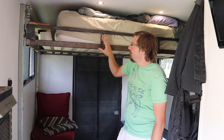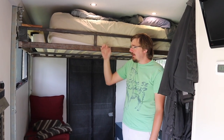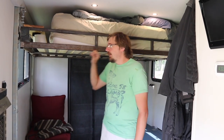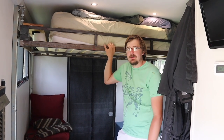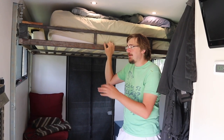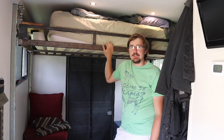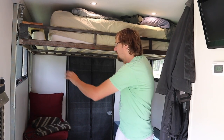Behind me is the bed frame on an electric hoist. This allows me to lift the bed out of the way during the day to use the back door and have extra space — great if you have people over. I can lower it to a halfway point where you can just lay in bed and look out the window, or bring it all the way down to the cabinets for more privacy in town. One advantage is I can level the bed across if parked on a cambered road. The winches are made from a Walmart drill married onto a Harbor Freight boat winch, and the controls allow individual up or down control on each side.